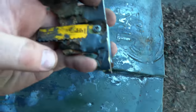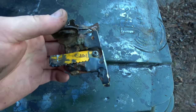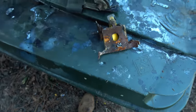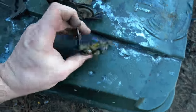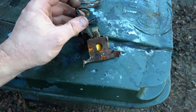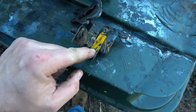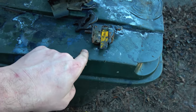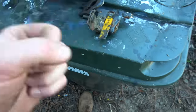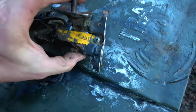But what gets me the most is the DeWalt Sawzall blade that's in here, the JB Weld, and some kind of sheet metal screw. This is what was holding the majority of it together. And what I fathomed that this was doing, because this is the peg that the pawl gear is supposed to lock into, it wasn't locking into it at all. And rather, what they were trying to do was push the e-brake handle into here. Rather than grabbing the peg, it was hitting here. You can see the wear mark. And this blade was used to force the e-brake sideways. So it was kind of retaining it, or forcing it to go to one side, which is why when you would lift it up, it would get disengaged, it would move to weird spots. It just didn't feel right. Everything about it felt wrong. So this was somebody's bullshit design right here.